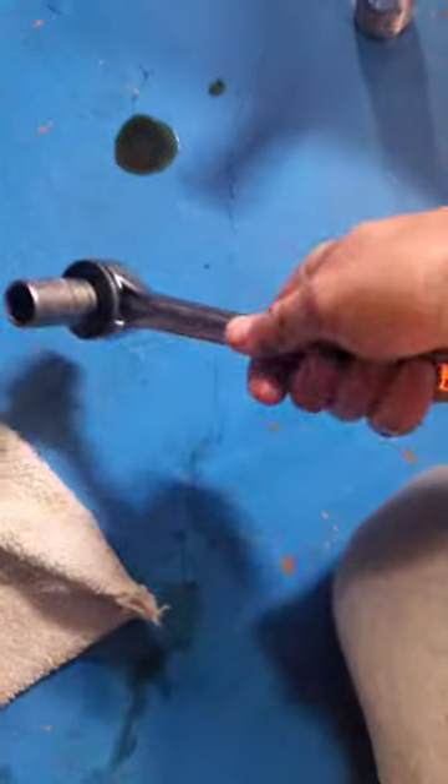Put this back up wherever the hole is for the pan and just screw it back in initially so you can get in there, then tighten it up. Either follow the torque specs or don't tighten it all the way to where you'd strip that bolt — that'd be a pain to replace the threads. I'm doing it just hand tight with maybe not even a quarter turn.